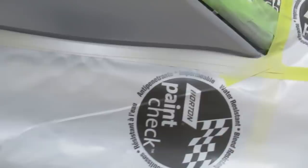I just spot primed the repair here. Epoxy sealer. Epoxy sealer on the front of the car. And the other repair there. And just over top of the black seam sealer to maybe help the white cover a little better. The rest of this is already in epoxy and it's already sanded in 600, so there's no reason to just keep pouring material on it.